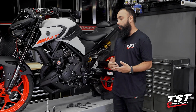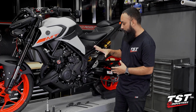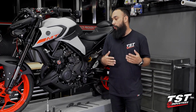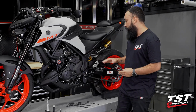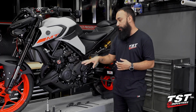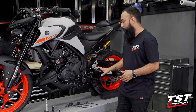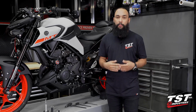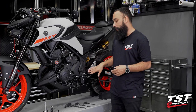However, if you do have a bike we don't carry a lot of products for, or if you have an off-brand rear set kit from Gilles Tooling, we will absolutely try and get you any replacement parts you may need. During this installation process, you do want to reference your owner's manual for these products or our installation videos for specific torque specs. And for the rear sets components in particular, you may want to apply a little bit of blue or red Loctite onto the bolts securing these to the rear set base.